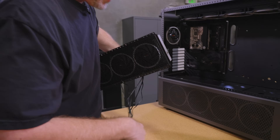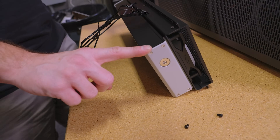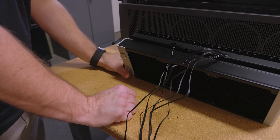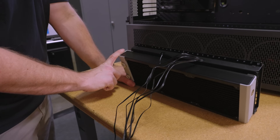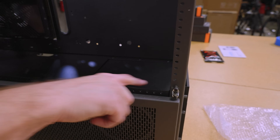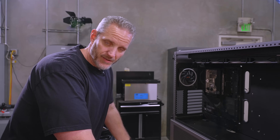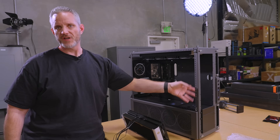I was saying I'm not even 100% sure I want to run the front radiator on this. If I want to run a front rad now, I have to go with the slim version. That extra room would allow me to slide the radiator up there, and then the fittings have to be on the bottom because there's still no room between here and the rad for fittings on top. Until I have the distro plate — which Singularity Computers has already shipped — I can see how far forward it comes. Daniel at Singularity Computers did say he designed it with 360 rads in the front to be compatible, so I need that here before I can figure out my next step. I would have loved to have had a 360 on the front just for the overkill aspect of it.